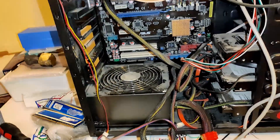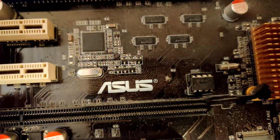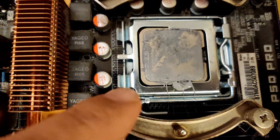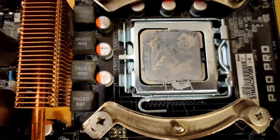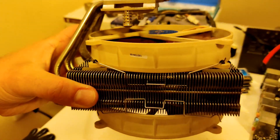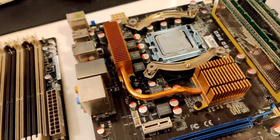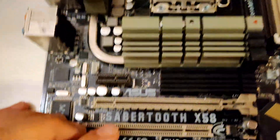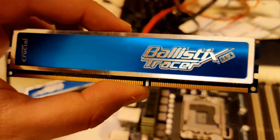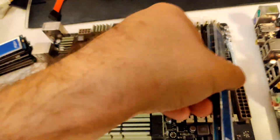So goodbye my current configuration — you served me very well. It was a pleasure. And welcome my new configuration! So guys, this is the Asus P5Q Pro, and I just removed it from the case. You can still see there is some thermal paste applied on the Xeon 5460. And you can see the big Noctua — this thing is really huge. You can run it in one-fan mode or two-fan mode. But this thing is so huge I'm not even sure if I want to install it on the new motherboard. So this is now the new motherboard — the Sabertooth X58. New in brackets, because apparently it's about 8-9 years old. And this is the Crucial Ballistix Tracer DDR3 RAM I'm going to install — each stick is 2GB, so six sticks altogether fit very well here.